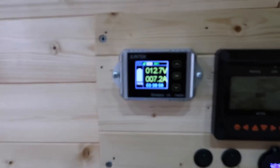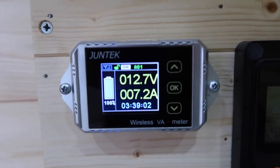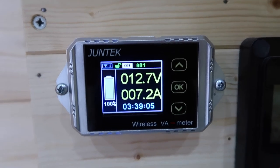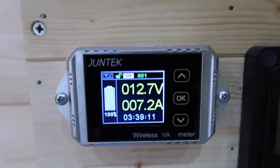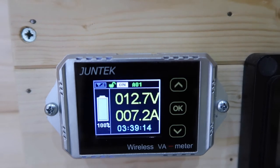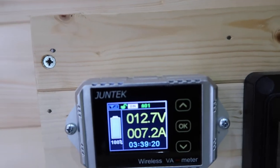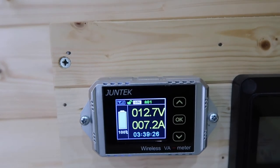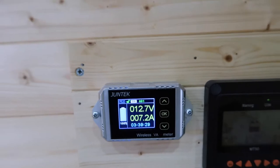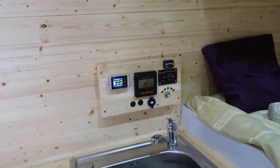As I was saying, it's often good to talk in terms of amps when you're trying to work out the power usage of a van. The fridge uses between 30 and 40 amps a day. The lights probably use 15 to 20 amps. If you had a laptop, that would use some too. So I've configured this van to use about 100 amps per day. I'm saving loads of power now because in the last fit, there was a fridge freezer sat here.